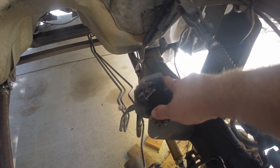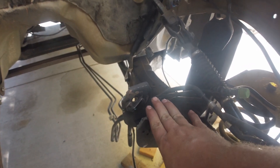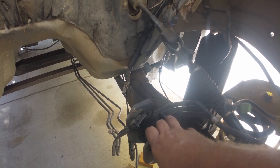This one is actually going to come down even further because I'm going to try and see if I can use the truck manifolds, and if not I'll just go buy the V8 Colorado manifolds. But right now I can tell it's already going to hit this point. So you take the mounts out of the box, check clearance on the factory towers for the motor mounts, and then bolt them onto your motor.